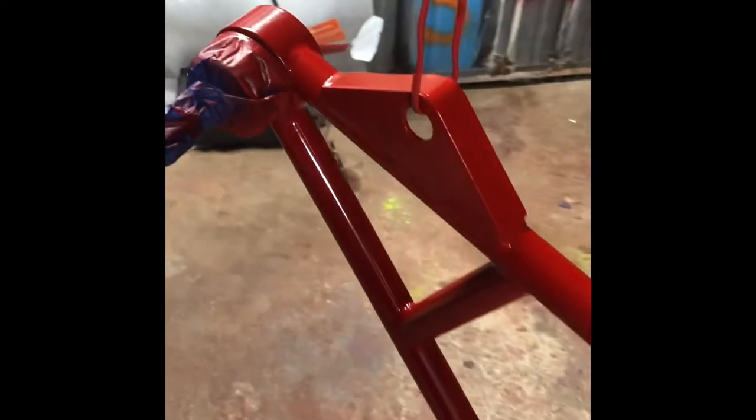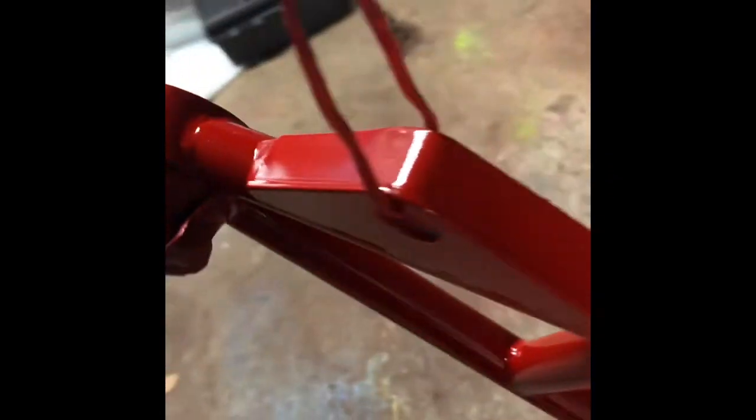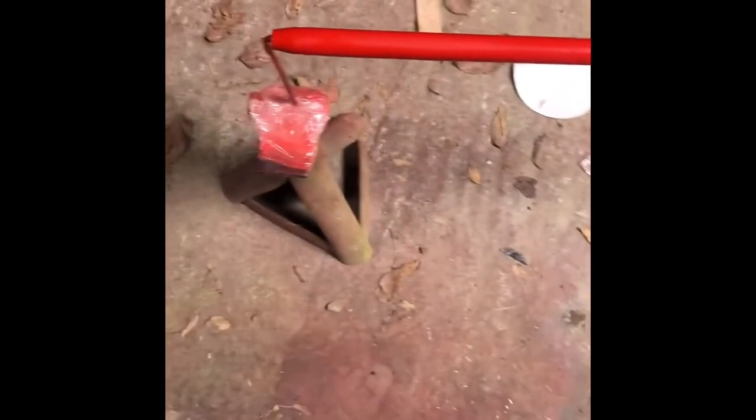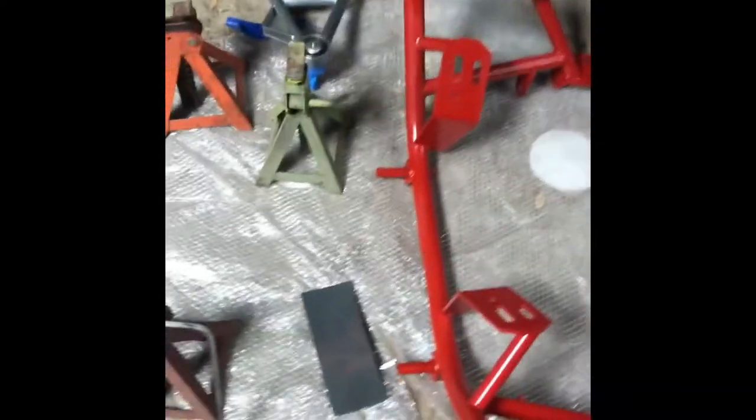Back again — I said screw it, just went to AutoZone and picked up another can. This is the final coat on this a-arm. I got this a-arm warming up, getting ready to paint. I got a rod that I'm going to stick through the bolt holes and then rest the lower ball joint part on, so it'll lay down where the ball joint is sitting. Don't touch it at all while it dries overnight. Also painting the harness bar and got the rest of the parts right here.